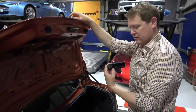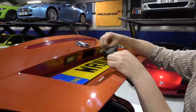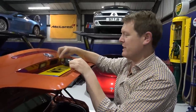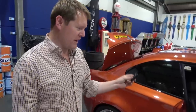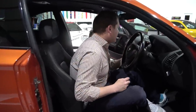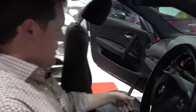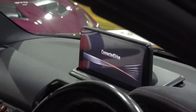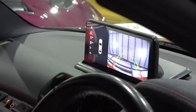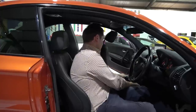There's nothing obvious as to how that actually connects or disconnects. Then checked a video which said you just use a pry tool — a trim tool — and that pops out. Super easy. I told you it was going to get harder a little bit later on. We're not at final installation but the cables back there are plugged in and the camera is pointing up towards the roof — we're going to see if this is working. Turn it on for a moment, try and get the system live, and I think as soon as I go into reverse it should show me correctly. Got parking sensors — we've got the camera! We can see the sky — technically the ceiling of this museum. And that is a very OEM BMW look. Success.